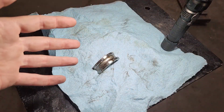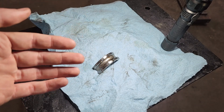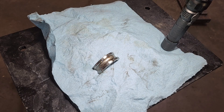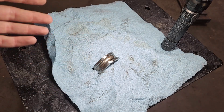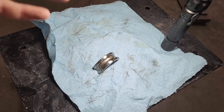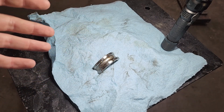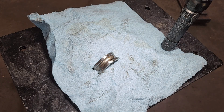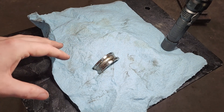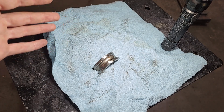So you heard the milling noise. Now the question is what causes it, and the answer is kind of complicated — there are a couple of different things. The first is coolant intrusion: if there's coolant intrusion into the motor, it can cause the grease to get washed out of the rotor bearings, then corrosion can start to form in the races and they start to make noise. Cause number two is dependent on when the motor was built. If it's a really early large drive unit with steel rotor bearings, there can be wear pattern issues caused essentially by arcing through the races and balls of the bearings, going from the rotor shaft to the actual case of the motor. On later iterations starting in 2014, Tesla started installing a hybrid ceramic rotor bearing, which is non-conductive and eliminates those issues on the rotor itself.